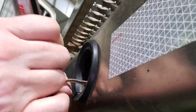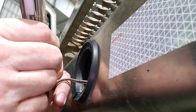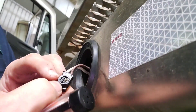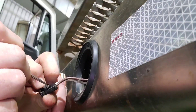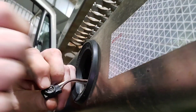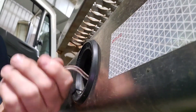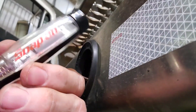You know there's power there. On the older style plugs you can also touch the ground on it. The ground on this one is in there, but if you could touch the ground and then touch the positive, you can check both. On the older style where the prongs stick out further, you can check your ground that way too. Just a quick yes-or-no — easy diagnostic. It's better to do this than to replace the lights outright because they get kind of expensive.